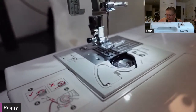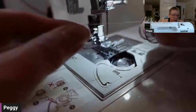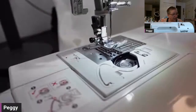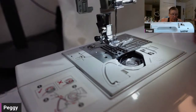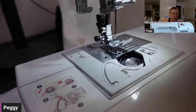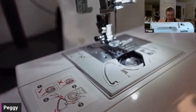Okay, so what I've done is my bobbin goes like that, right? Comes off from the top. What's going on with that? I had to take that bobbin off like yesterday, day before, because sometimes what will happen is once you get to the end of the bobbin, the tail will pop loose and start getting in the way. Or you've got a table full of scraps, and an extra piece just gets pushed in by the needle, or you're changing things around. A little loose piece ends up inside the machine for one reason or another, and you end up not knowing it's there.